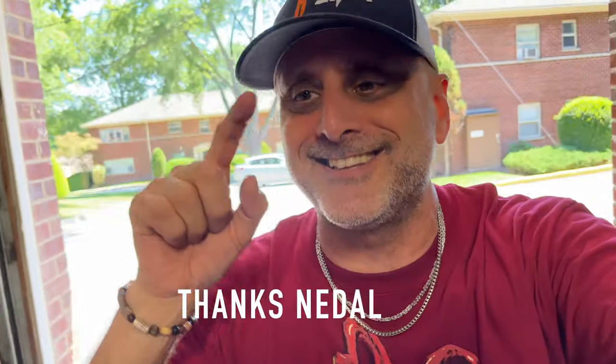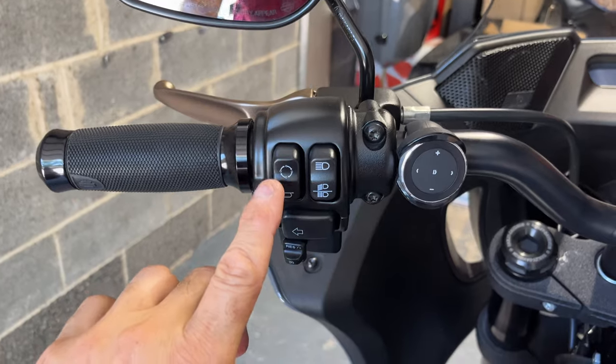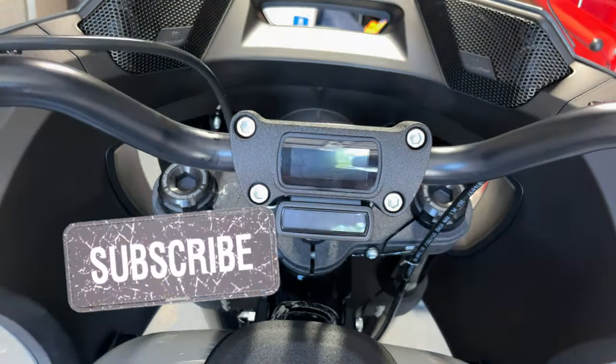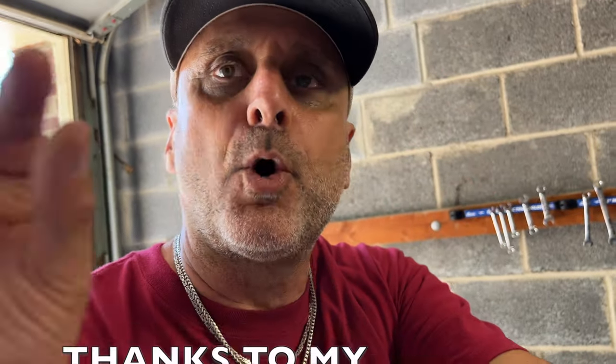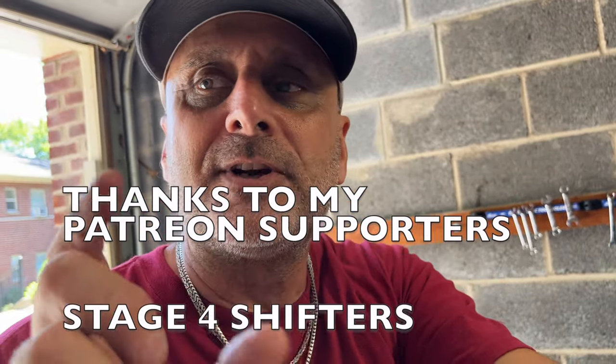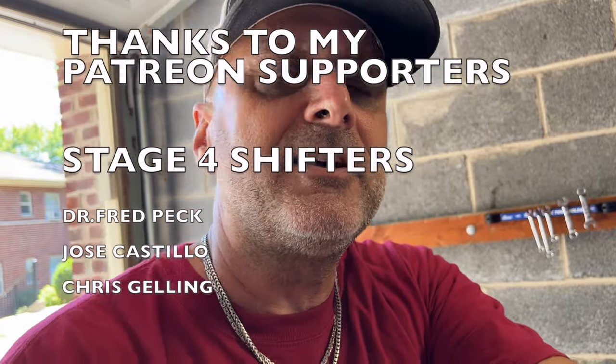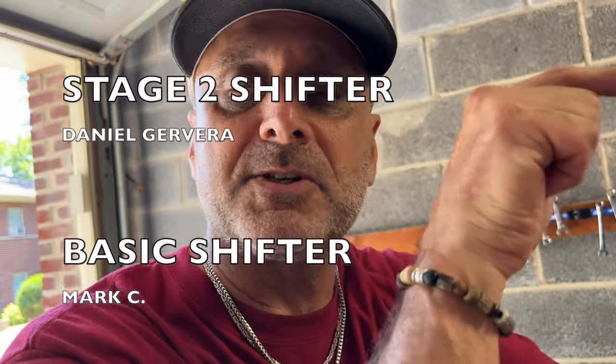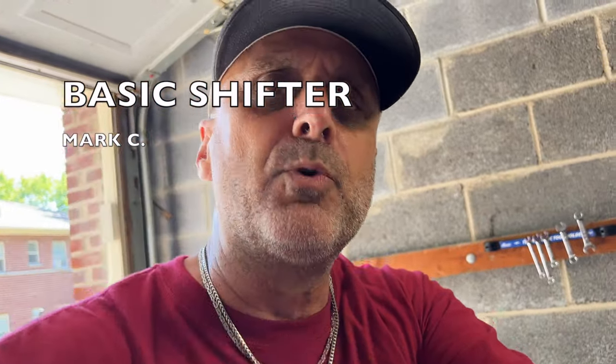I would like to thank Nadal, he called me and walked me through it. It's pretty much turning the bike on while this is pressed, and then every time you click, it shows you the next code. If it says ABS yes, like Y, that means there's a problem with the ABS. Then you click on it once, it shows you what code it is. You run that code on the internet, it tells you what part is problematic. And then it tells you, do you want to clear? You press click, and it clears it. We went through all the parts that had to do with me disconnecting all these wires. So that's one thing I wanted to talk about.